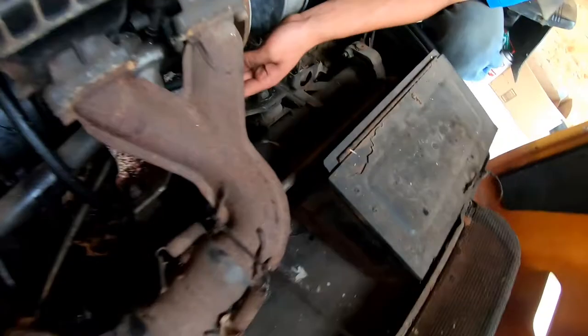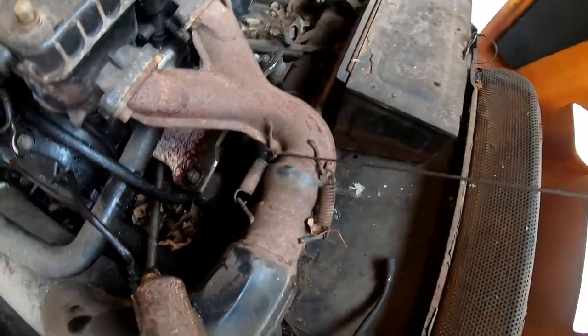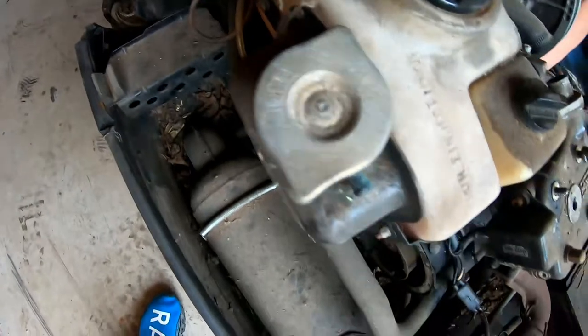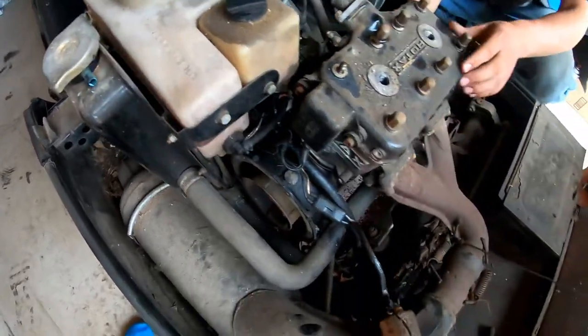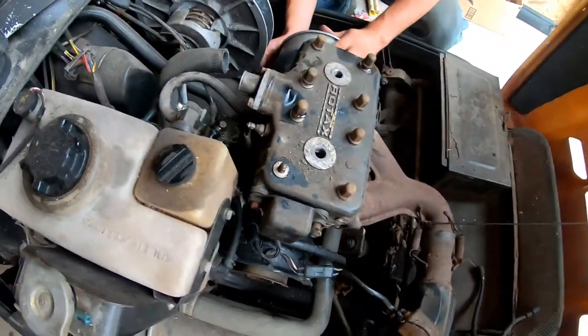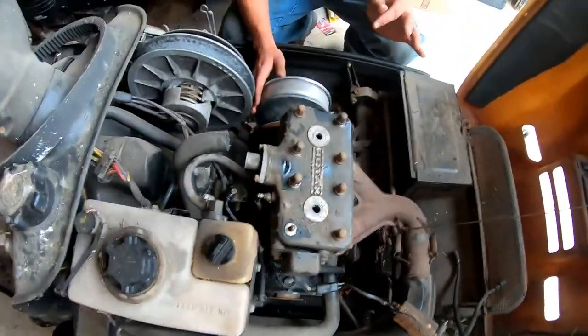This is the hose. Did they take that off, or is that running up to the... That runs up to the oil tank. Okay. Yep. And that's pretty standard. That cools the rotary valve and the bearing underneath there. So there's a hose here feeding the top. That's why this reservoir is always going to have oil in it. So we may just take a 13 and pop the head off, and then we'll just inspect it, because we could see some deterioration, detonation.